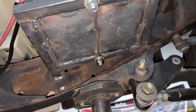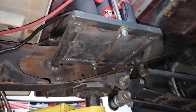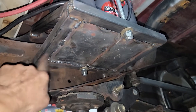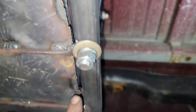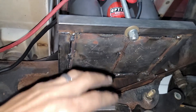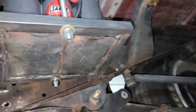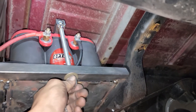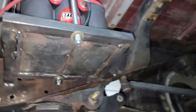I grabbed the battery to fit it in and out — and I'll be honest, maybe this is what happens when you try to rush through stuff or your mind is focused on getting it done quick. I actually welded the whole thing in backwards and upside down. Instead of getting it off the frame rail and redoing it, I just took the plasma and cut the tin out, knocked it out, made a gusset, got it in, set the tin back up in there, and welded it back in. It wasn't horrible. I was a little disappointed, but it looks good and the battery is nice and secure.